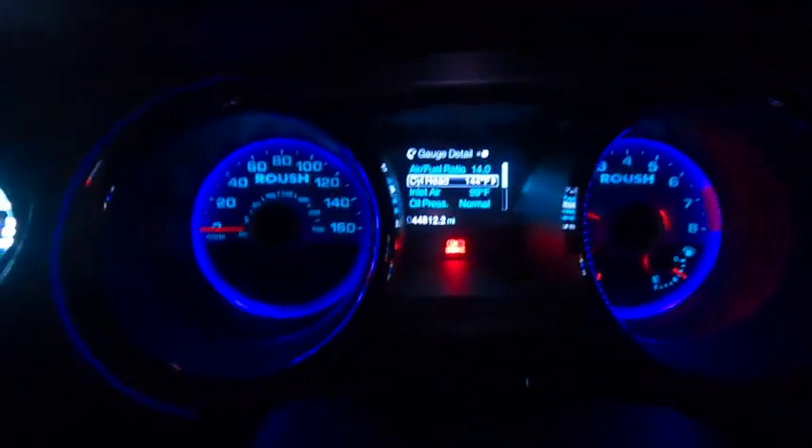A few degrees cooler on the actual heat exchanger itself. It's dry heat out here — it is what it is. The car definitely behaves a little better; it doesn't get as heat soaked. I just started it, the car isn't even warmed up yet, and we're already at 144 or so. It starts measuring at 140 and goes up from there. Our goal is to stay under 205-210°F. I've already seen results. After the dyno tune, my main fan kicks on at 190°F, so once they're all going the car just stays way cooler. I'll show that off tonight — stay tuned.